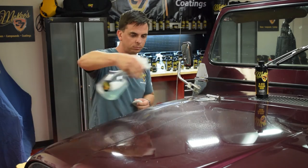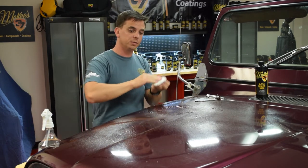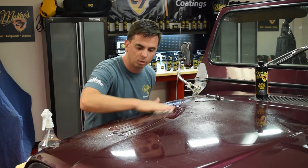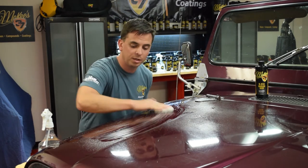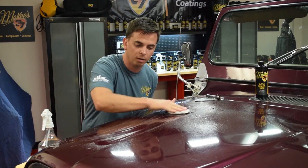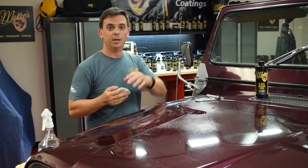Take some lubricant and spray it on. You want to hold the bar flat — what you don't want to do is put it against the tip of your fingers because as you rub it, your fingers will wear through the bar. There's really no science to using a clay bar — you just want to rub it back and forth really fast. It should only take about 20 or 30 minutes to clay an entire full-size vehicle. This is one of the most rewarding aspects of car care because there's a huge visual difference before and after, both in the way the paint looks and your clay bar, as the clay picks up lots of embedded dirt and contaminants.